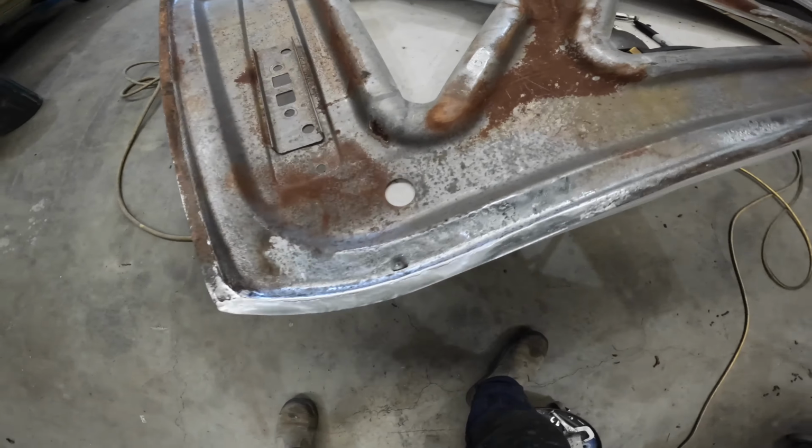From there we two-pack paint, just a satin black. Pretty much as per factory spec looking. It's probably just a little bit better coverage like this and better protection for the future. Then we remove around the edge of the bonnet frame the black paint in spots and copper spray, copper weld through prime spray. Once again, trial fit the boot lid on the frame, trial fit it to the car, just checking gaps.